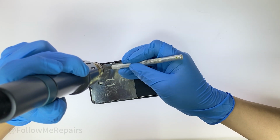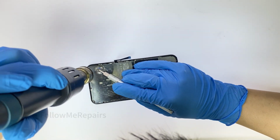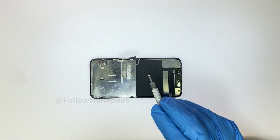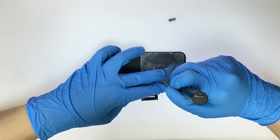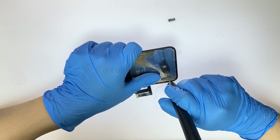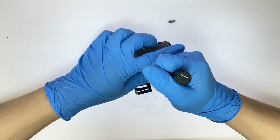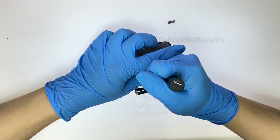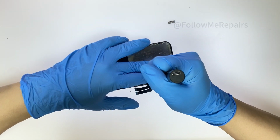Use a 550 degrees Fahrenheit hot air gun to blow the chip directly off the old screen. For safety reasons, we are preparing to manually grind the BGA chip pads. We will show you the process of grinding the chip at 4 times normal speed without any deletion.